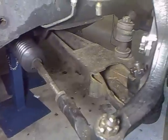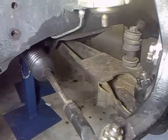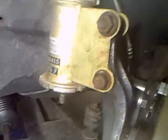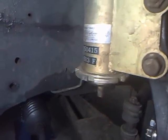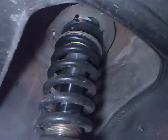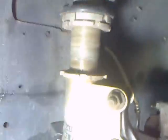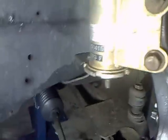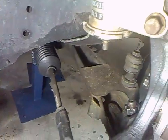I'm running the standard Z control arm, which was pretty easy. The only drama with this setup is you'll have to get a base-height-adjustable coilover because it's way too low with a standard coilover — even standard suspension it's exactly the same. You'll also have to get an adjustable hat. You get a massive amount of positive camber just from running the standard Z control arm. Later on I'm playing around with a Silvia control arm to see if I can get that to fit, but stay tuned.